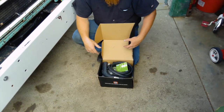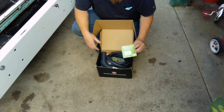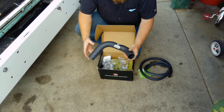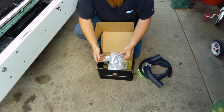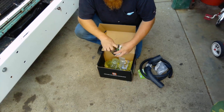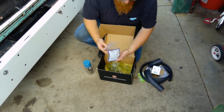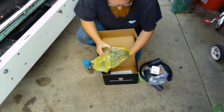Out of the parts box, I've got a brand new water pump. Inside at the shop we've got a few pieces: a pinion seal that I'll eventually get in — won't worry about that today. These are two pieces of heater hose, 5/8". I've got a new lower rad hose, gaskets and plugs for the water pump, new hose clamps for everything, paint to paint the water pump the same colour as the engine, some bulbs for the cab lights, and the water pump itself.